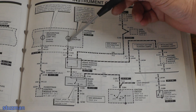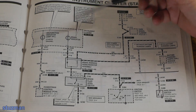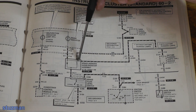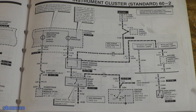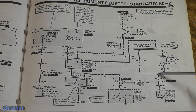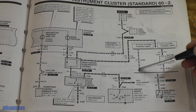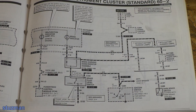Now we're left with: is it a bulb or is there a problem on the ground side? Let's do the easy part first and follow down this wire. We go off in this direction, coming up, coming over - and in my case without daytime running lamps, we come down, going through here, and now we have the park brake switch. When the parking brake is applied, this switch will close, applying a ground on this wire all the way back straight to the bulb.